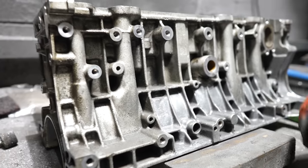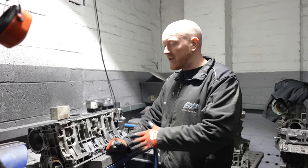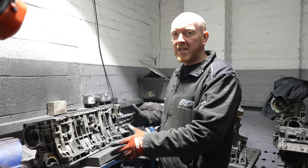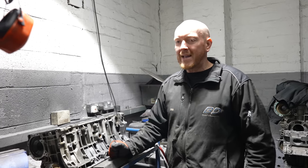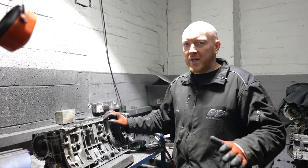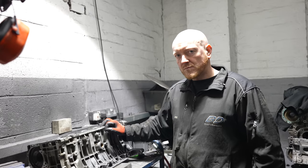If you get all that loosened off and we get them in our hot jet clean at the end of it, it's as good a result as any, especially when it comes to getting painted. You just need a nice clean surface. I appreciate the vapor blasting might give you a nicer look if it's going in its raw state. However, what we have found is that you tend to spend more time cleaning all the media out of all the galleries. And if you don't get all that out properly, you're in trouble. In the future, could that wear away internal parts of the engine?